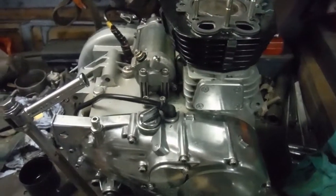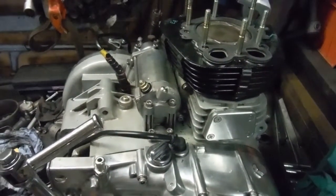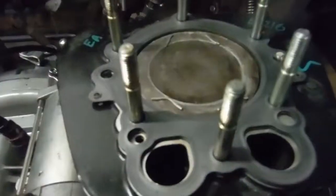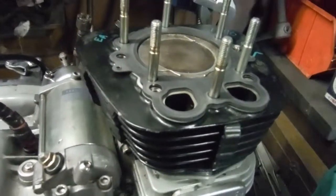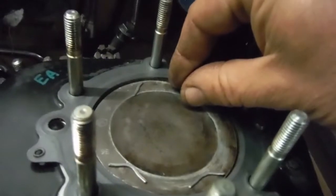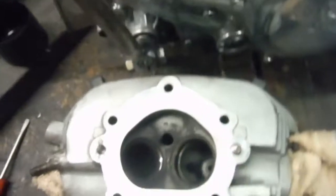Here's a Royal Enfield 500cc unit engine, one of the new Indian unit engines that I'm working on. I've already fitted a performance camshaft kit to it and I've also set the piston-to-underside-of-cylinder-head squish clearance, which I've checked and measured using strips of solder on top of the piston. I shortened the cylinder barrel by 0.8 of a millimetre to get the solder down to 1mm thickness after going over top dead centre, which indicates we've got a millimetre of squish clearance — that's where we want it to be.